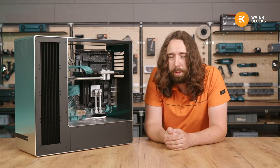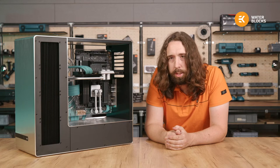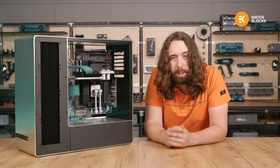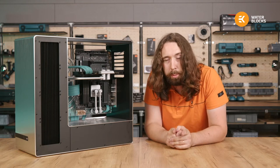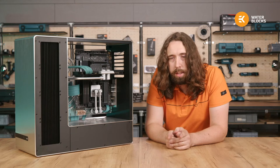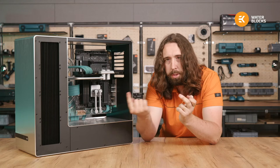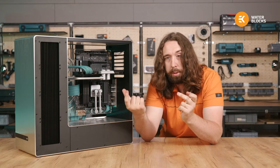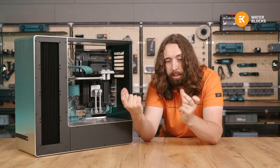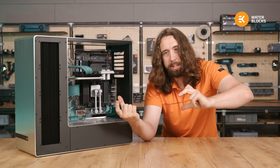I did have some problems with them being loud, and I'm really impressed with how quiet the EVGAs are, so that's what we have here. But generally, one other thing to consider, while a 1-to-1 pinout sounds great on paper, it's not the same as making an extension, because when it's male to female, the one position remains in the same place. But when it's female to female, then they're no longer in line because they wouldn't make a circuit. So the other side is actually flipped.